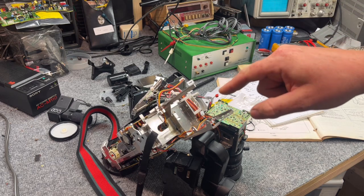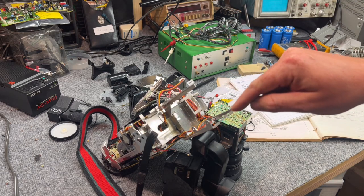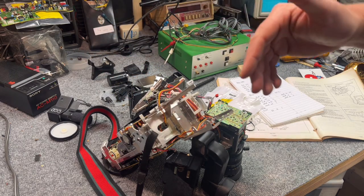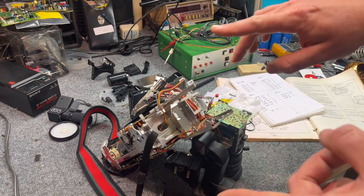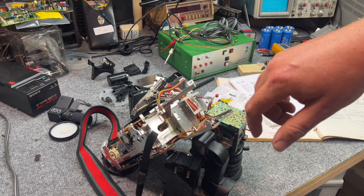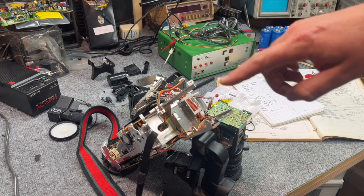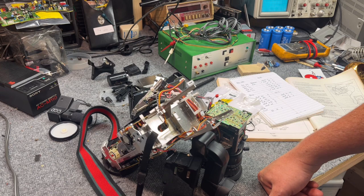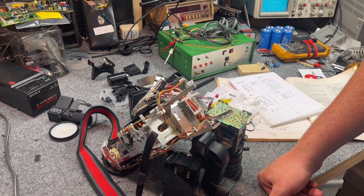The complaint with this camera was that when you put a tape in it would thread but the drum wouldn't rotate. Normally when you insert a tape, the machine threads it, pre-rolls for a few seconds, and the drum rotates because it records briefly. There was no drum rotation, so we were hoping it would be something simple like a belt — but I honestly haven't seen the belts actually break on these; they usually just get loose or indented.